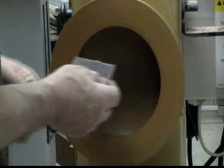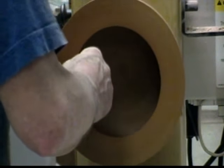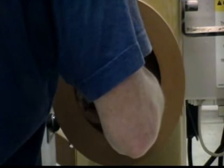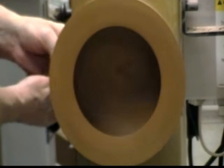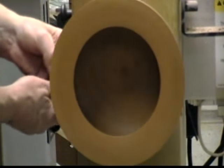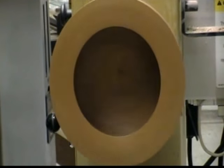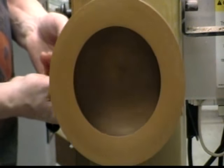Look at that. It's a great system because the oil helps to lubricate the action of the paper, so you cut down on the amount of dust that you take into your system. Of course, if you're doing this at home, I wear a mask all the time. So I use the 100 grit anywhere that I wasn't able to reach with the disc. So that's down here as well, down here near the back, where it clogs the paper. Now with this Abranet stuff, you can declog the paper very easily, which you can't do with regular paper.